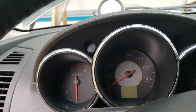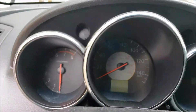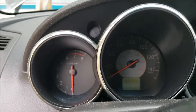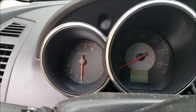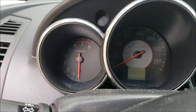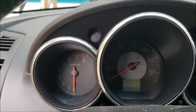I broke the bolts free between the front catalytic converter and the exhaust pipe and pulled it back a little, so there's a slight exhaust leak — not a full flow leak, but it should be just as good as having the O2 sensor removed. I put the O2 sensor back in and now we'll start it up and look at the vacuum gauge again.